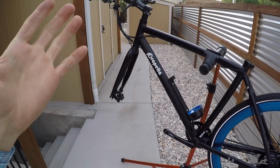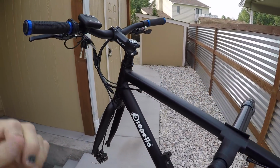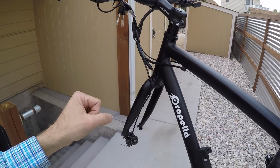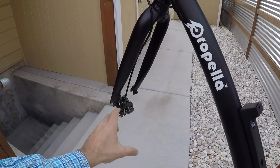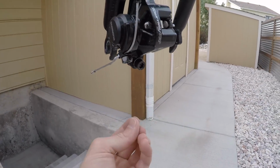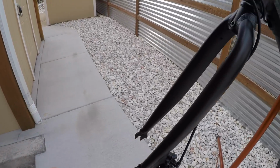So that's something that happens a lot when you're assembling an e-bike, especially with hydraulic brakes. You're pulling on, maybe just grabbing the handle for stability while assembling it, and then the pads get stuck together and they're hard to get apart. You have to stick a screwdriver in there and wiggle it.